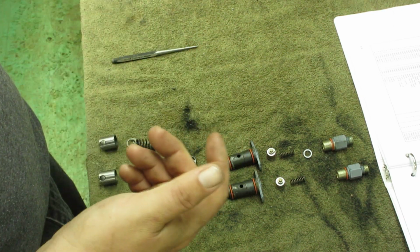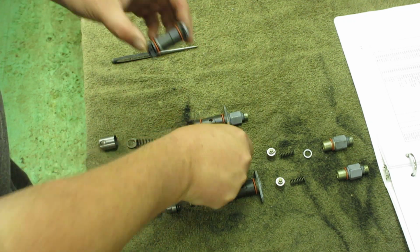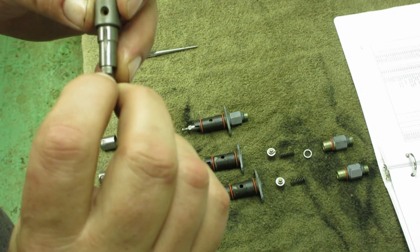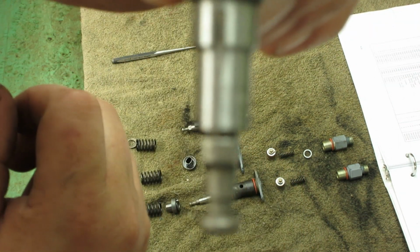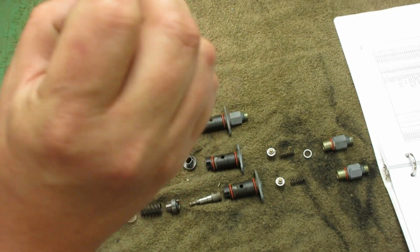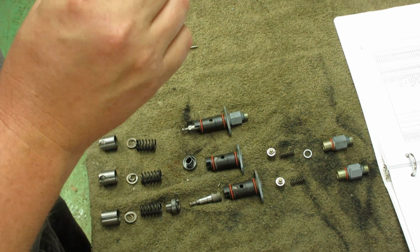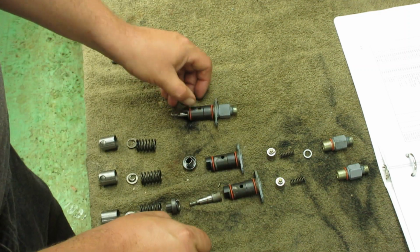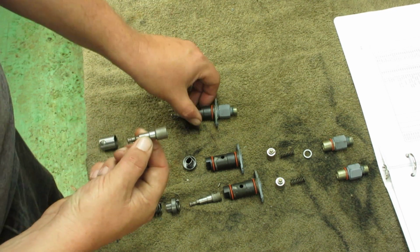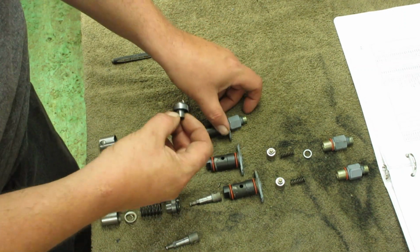Well, shoot. So now I gotta take it apart again. Well, let me see. I don't have to take it apart, because there's different writing on the injection, on the things. So see where it says M30? Focus. Anyway, it says M30 on the side that's supposed to go towards the hole, and it has the Zexel Z on the other side. So the M30 is supposed to go towards the hole. And which way does the hole sit in there? The hole sits in there in the back. So that's correct. Okay, all right.